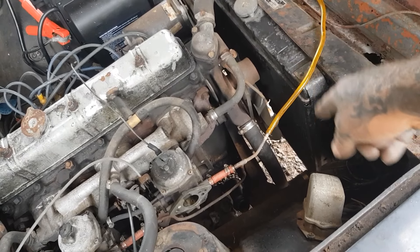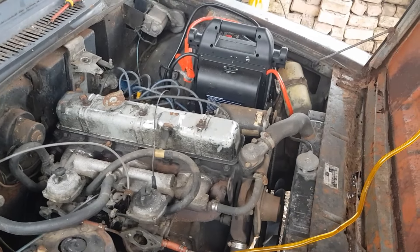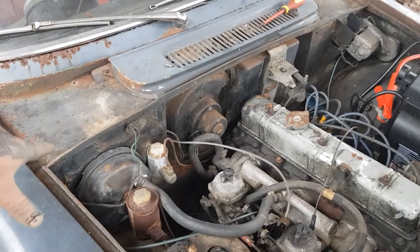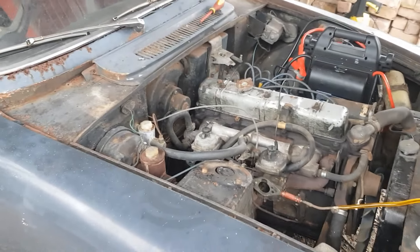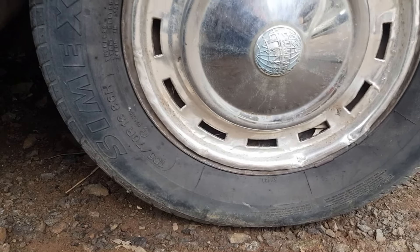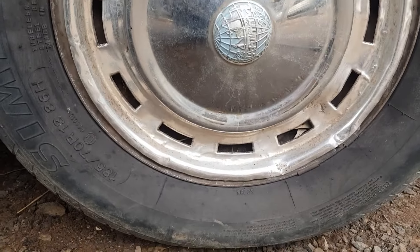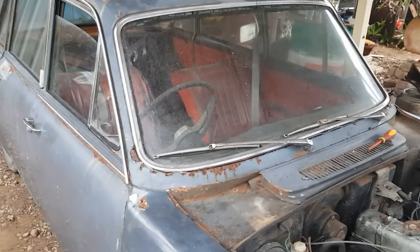The fuel pump was pumping a bit there, so we don't know — it might not have any petrol in it. We'll get that sorted. Hopefully the fuel tank's okay. We'll look at the clutch — we've got to bleed the brakes and the clutch, and the slave cylinder might have to be rebuilt. We'll throw a battery in it. We'll check the tyres out — not sure if they're 13s or 14s. If they're 14s we are in luck, and they are 13s. I'm not sure if I've got any 13s — they look pretty ratty, so we'll see what we've got. If we have to buy tyres that'll blow our budget a bit.